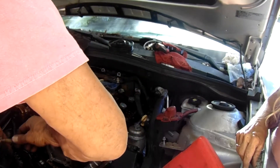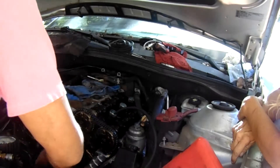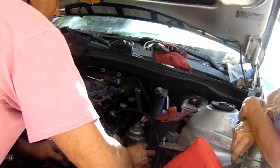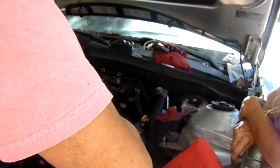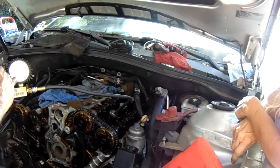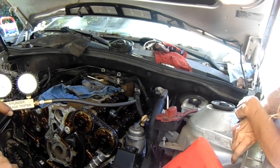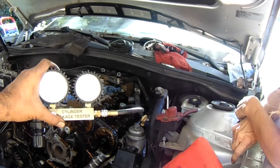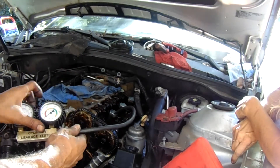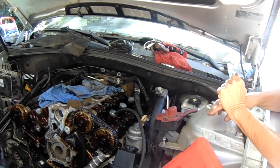Turn the air down. You see it? Oh, it went way up. You'd probably get a different reading on all of them if they were wet. We're at 80... now we're good again. Wet test, bad oil. Now we're at 100%. Y'all at 100% now with the wet test. The car has been sitting for a while, so it's dry in there — you're not going to get the seal, because that's what oil does, it seals up the motor with the rings. The rings are okay on that one. We're good on this side. We need to fix the passenger side.